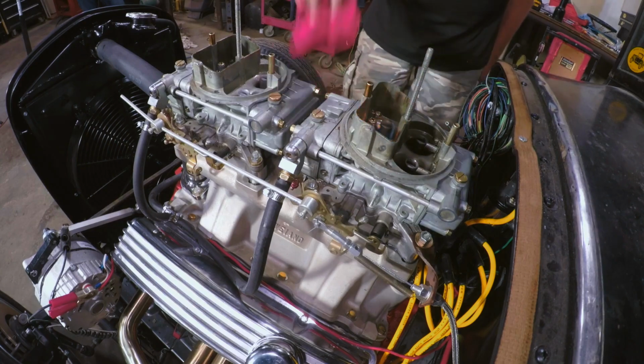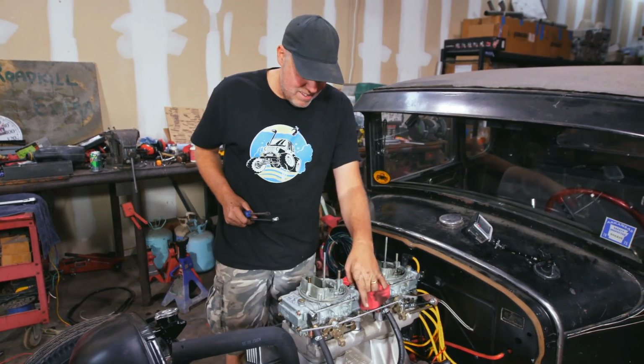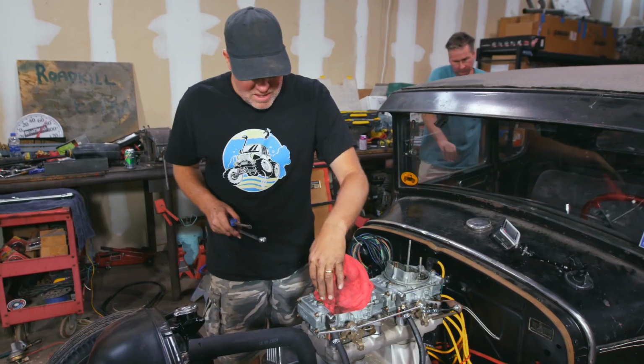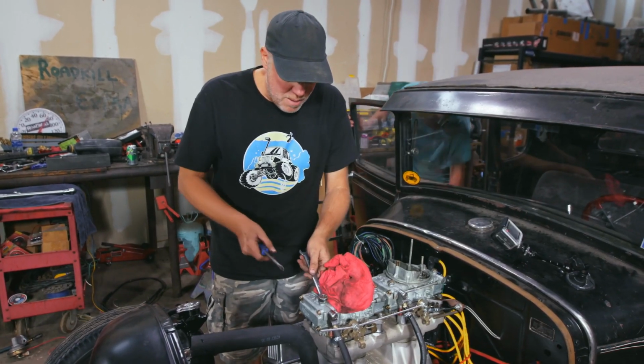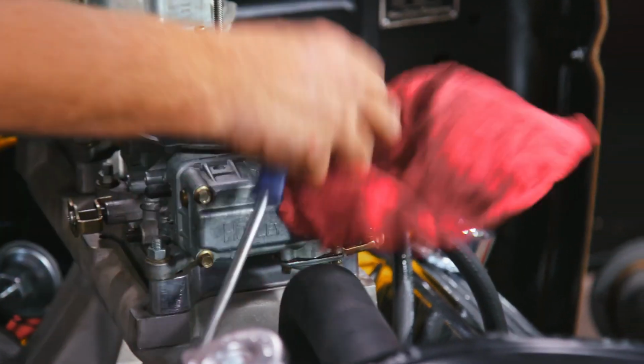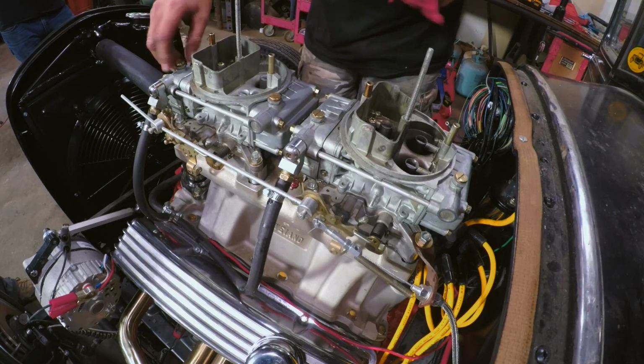You got gas everywhere here. So now, the problem is, it's gushing gasoline out of the boosters, and therefore the slightest lean pop backfires. Look at that, see how it's pouring out of there? Needle and seat's either stuck or completely misadjusted. That is jacked up.